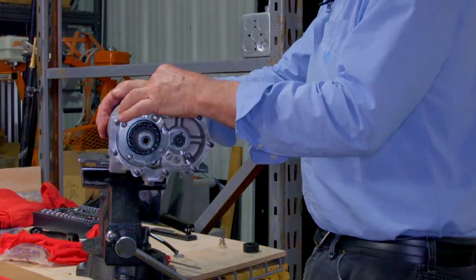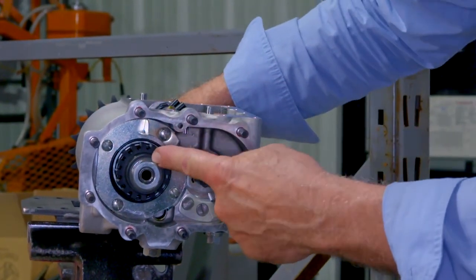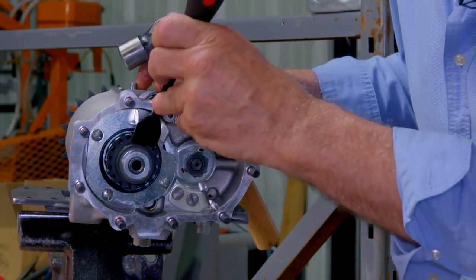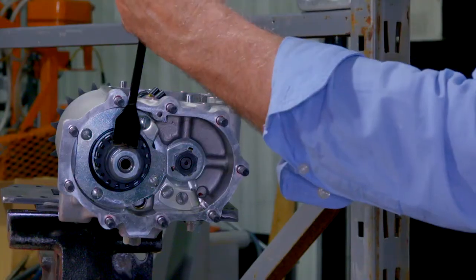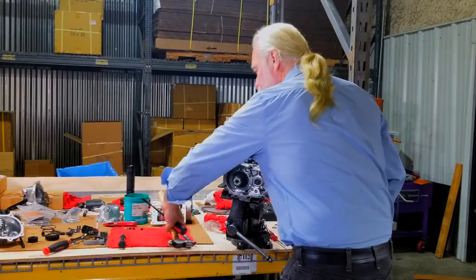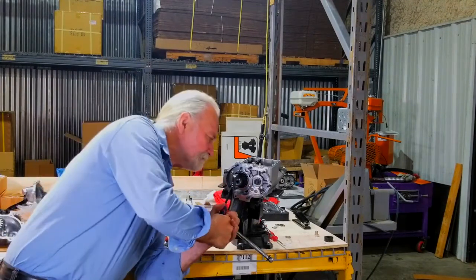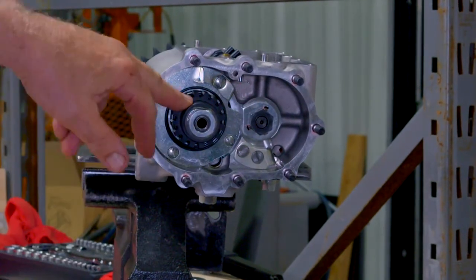Now I'm going to neutralize. And I'm going to rotate and find an area where I've got plenty of lip on that lock tang, which is only basically a thin strip. Even or perpendicular to a flat, I'll come on with a good strong gasket scraper or a fine, dressed chisel, locate and do a clean fold down even with the flat. Now I'm going to adjust my channel locks for a proper spread to this. And I'm going to come on with one good clean shot and roll that down proper. And that's it. Our assembly is now complete. That can't come off. We're locked into place.